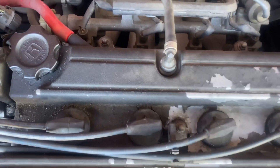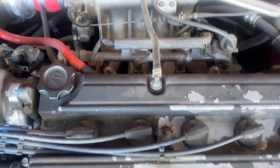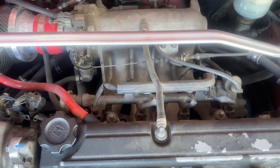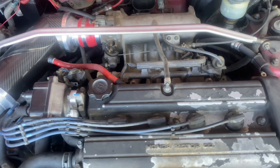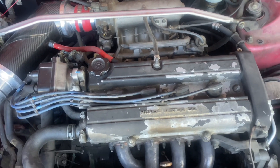The PCV valve is right here on top, as you can see on the valve cover, and it vents through to the intake manifold. What we're gonna do is vent into a catch can instead — that's how I had it on my original B20 VTEC like 15 years ago and that motor ran perfect, no problems.